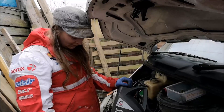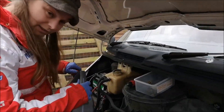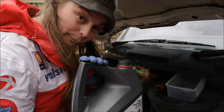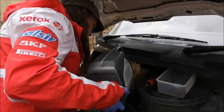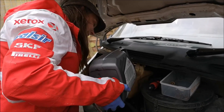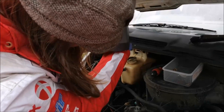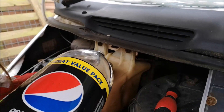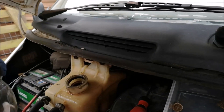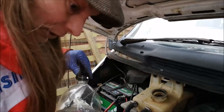I've already put a litre of antifreeze in — this is diluted, I'm doing it 50-50. We're using blue because it's an old vehicle — pink goes in modern vehicles. I'm going to put another litre of water in and see how we go. That's the full marker — the water's there, we're good. What we're going to do now is run the engine for a bit and let those air bubbles come out — squeeze the pipes and so on.